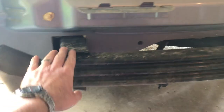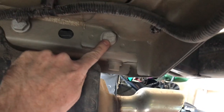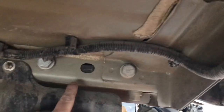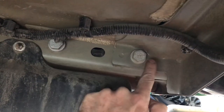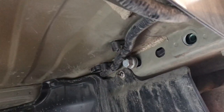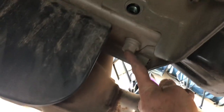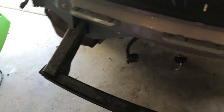With the rear bumper off, the next thing is to remove this piece — there are four bolts underneath and this should just slide out. Underneath this bolt and this bolt, and when we put the new hitch in there'll be a third bolt that will go in there too, but we've got to get these guys out on either side. That's a 21mm socket, by the way. There's also another bolt on each side that needs to come out before you can slide this out. Once that's out, it slips out with a good pull — chuck this away.